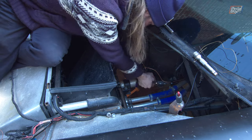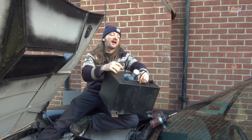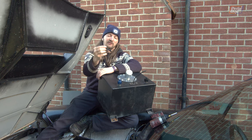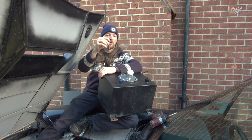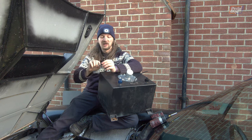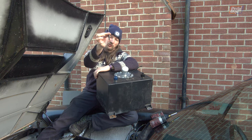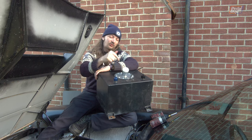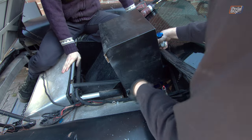There are two things left to do with the fuel tank. First, we have to put a connector on the sensor wire where we had to cut it off since we'd rigidly attached it to the rest of the car. Second, we've got to put a little vent on — this has a little safety valve in it so if we ever go upside down, fuel won't come out; there's a ball valve that seals up if inverted or if lots of fluid tries coming out. Normally it will just slowly bleed excess pressure out of the tank, so we need an AN-12 to barb fitting adapter. And the third of our two things is that unfortunately — Adrian was right — this does not fit back in the car with the neck on it, so we have to take it back off, put the tank in, then put it back on.